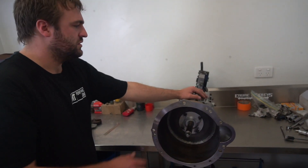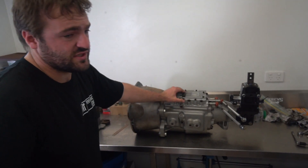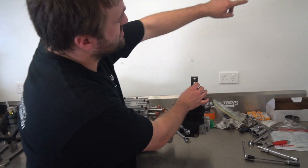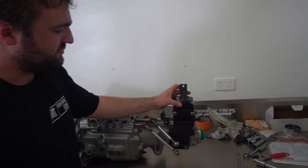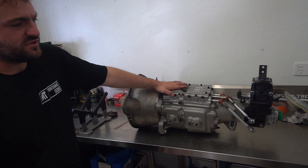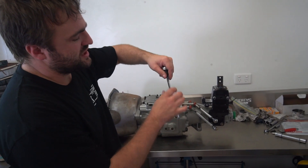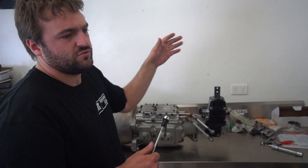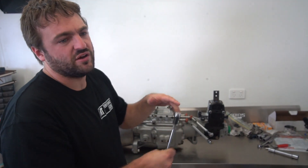I'll be utilizing the flat shift feature - foot flat on the floor with no clutch, jamming it into gears. I bought a strain gauge and a strain gauge amplifier. I'll be making a shift handle that comes up to me. On that shifter I'll be putting a load cell on, which basically measures the bending of an object - it would send a voltage signal to a strain gauge amplifier that converts the low voltage signal into a readable signal from an ECU, giving me an output. I can calibrate how much tension goes on that bar - it's the same way digital torque wrenches work.